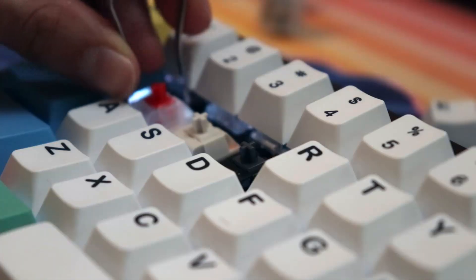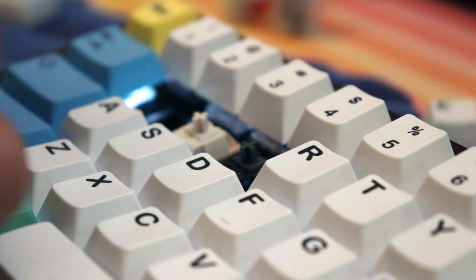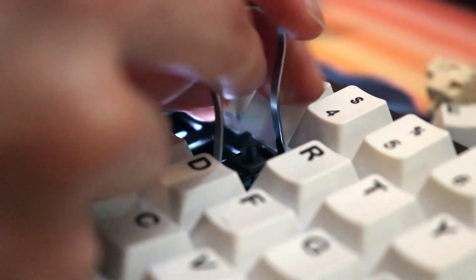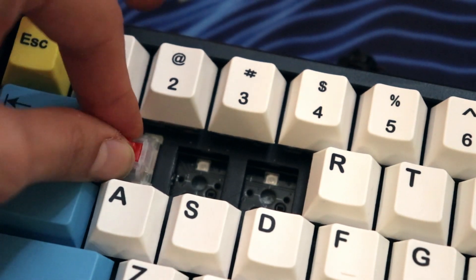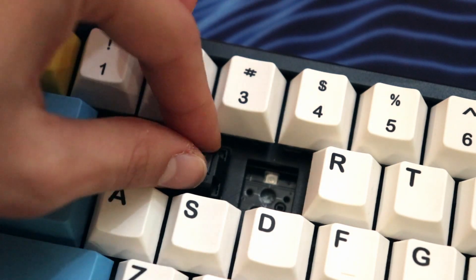So how do you replace hot swap switches on your keyboard? You get a switch puller — if your keyboard is hot swap it usually comes with one. It's a metal piece of equipment, usually bent or clip shaped with tiny prongs at the end, and you can clip your switches and then pull them out. I like to do a little wiggle before pulling them out just to make sure I'm not pulling too hard. You just pull them out and to put new ones back in you align the legs and push down really slowly. For information on what to do after you take out your switches, you can lube them — I'll link a video on lubing mechanical switches. You can also check out some of our mechanical keyboard reviews, and subscribe if you want. I'll see you in the next one.